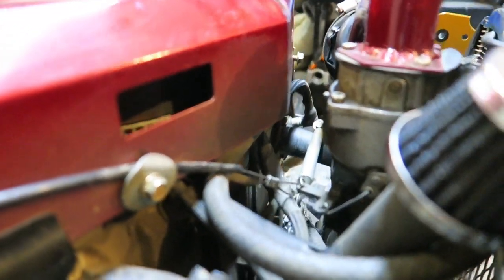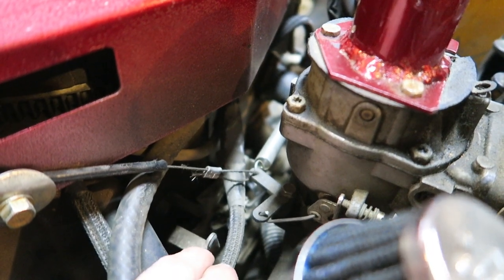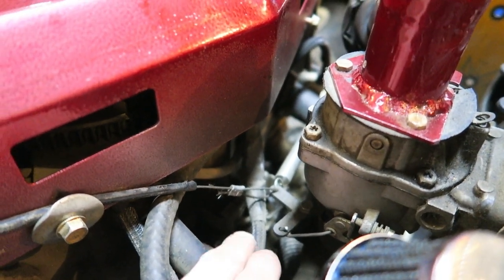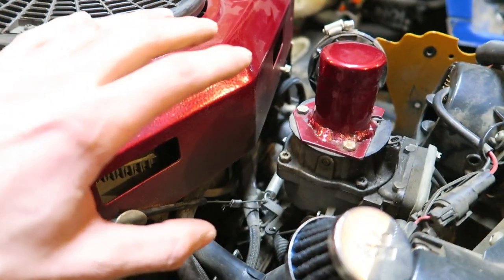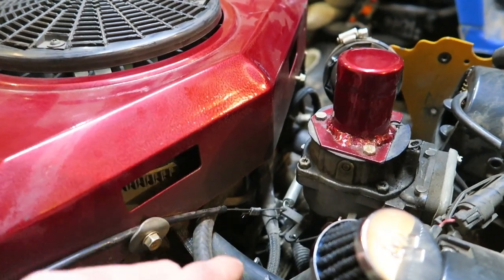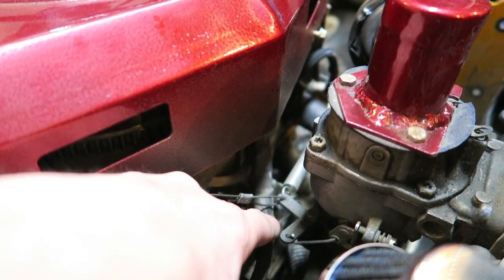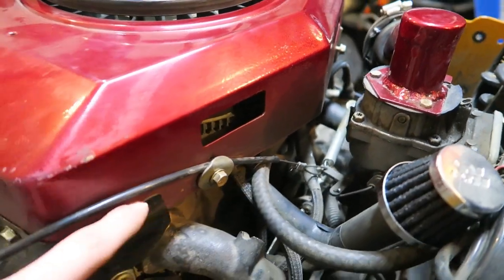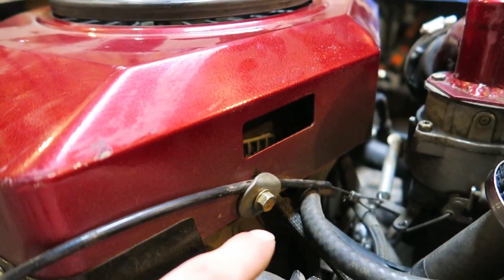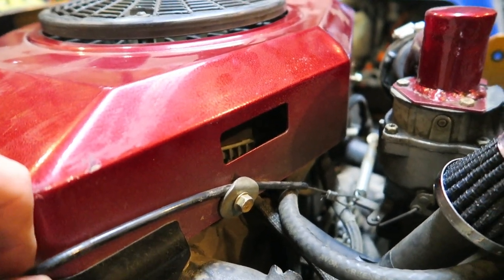Getting into the engine bay here, from factory we're going to have a linkage bar that comes off of the engine. This linkage goes down to a few different springs and other linkage bars and essentially goes into the motor to a gear. If you want to do a full governor delete, you have to actually open up the engine and take out the gear. What we do is a governor bypass — we take off the linkage that went from here to this little 90-degree arm, and then run our cable through a pinch block. It's just the normal bolt that goes through the engine to hold the cover on, and I bent up a washer so that it pinches the cable. This works absolutely flawless — it's a great solution.